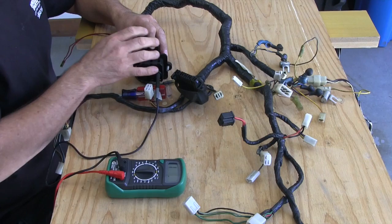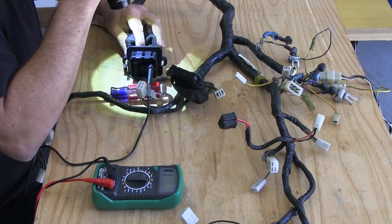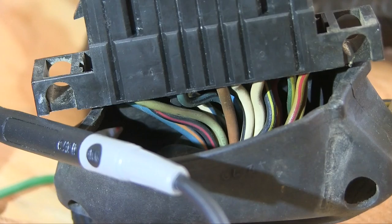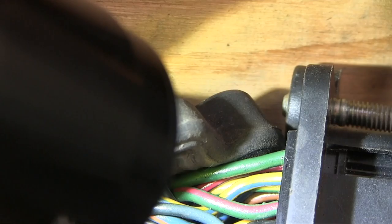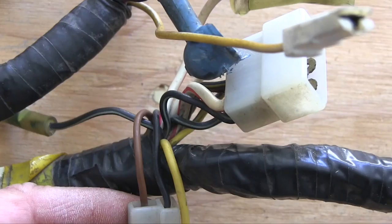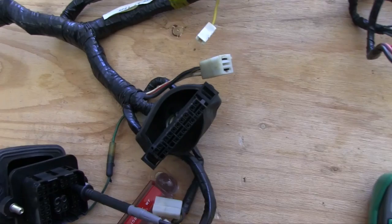Here is where the 76 loom is different from 71 through 75, which is what my manual covers. This third row from the top has a solid brown small and a solid brown large. There's no brown at all in the 71 through 75 wiring diagram. Looking inside the plug that goes into the firewall, there's brown large at the top and brown small below — two browns. That leads me to believe it's a new color for 76. The little brown goes to a connector over by the voltage regulator. I've ordered a wiring diagram; as soon as that gets here I'll find out what brown does.